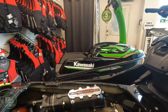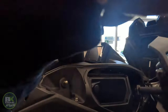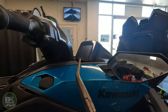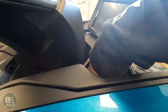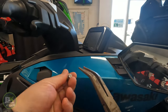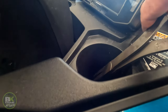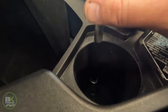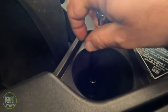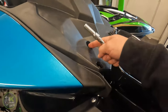The same this side first. So again, we grab the insert face down. It's easier if you close these. So insert, inserts in there. Again, grab our bolt, needle nose pliers. Locate it inside the hole, just let it sit there and you can grab with the socket. Alright, that one's tight. In the front of the ski, one, two, and the ones on the side there.